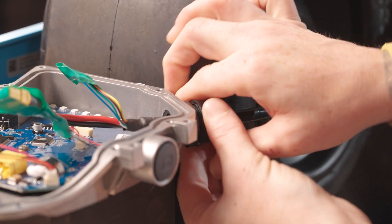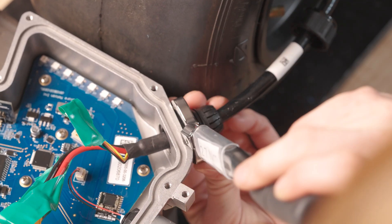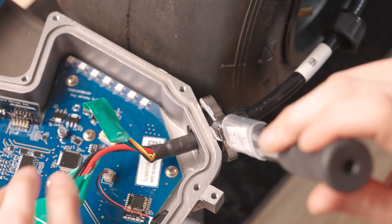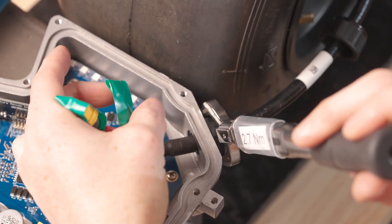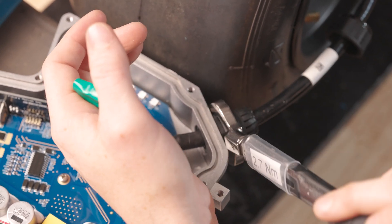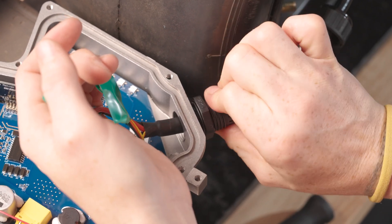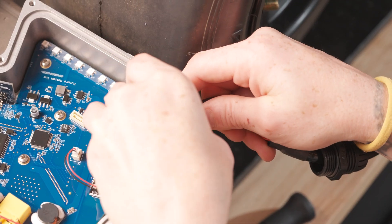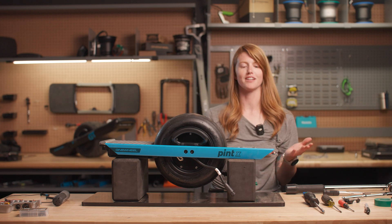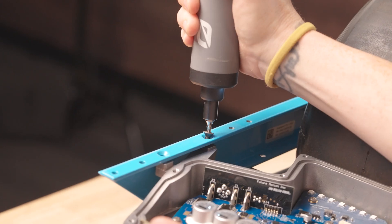For this wire we're going to use our thumb to push forward and support the wires with our fingers in back. You want to make sure you're not tugging on those wires — use your thumb to push, then cover this with tape as well. We're going to unscrew these, and you want to support those wires so they don't touch anything in the controller. Now your controller is completely isolated, attached to one side of the rails, so now we'll take that off.